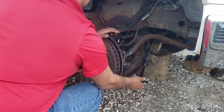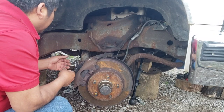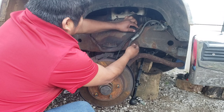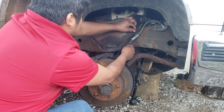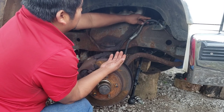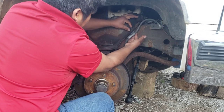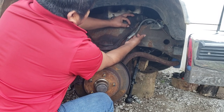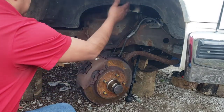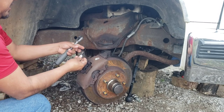In my case I've been working on my suspension, so this is my new strut tower right here, making it easy for me to go back and forth. If you want to, before removing this brake caliper, loosen up these two nuts to remove the brake fluid hose to give you some slack. But in my case there's no reason to do it — there's barely enough room and it won't make any difference.